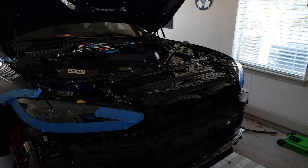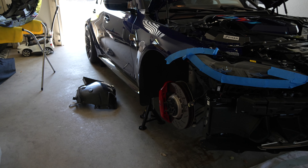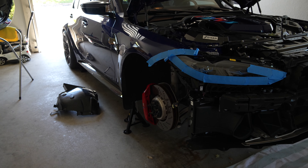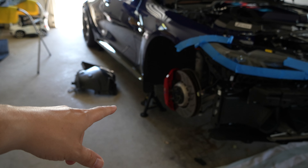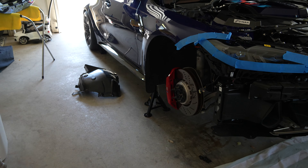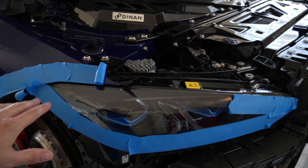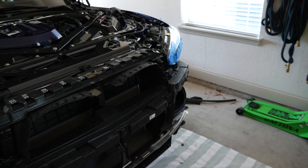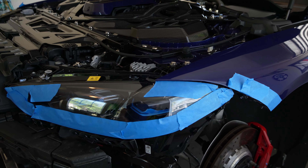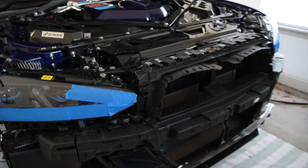If you are looking to do this job yourself, just keep a few things in mind. Jack stands — always a good idea, don't use jacks. I've had this car up overnight. Anytime the front of the car is up in the air, just put it on jack stands. They're relatively inexpensive — I'll link the ones I specifically use right here. They already have the rubber pucks on top, so they're able to be used without buying additional BMW pucks. Also, tape off the painted areas. This car is PPF and ceramic coated, so the front of the fender and headlights on both sides — just throw some blue painter's tape on there as you're pulling off the bumper. And pull both front tires off so you have plenty of room to work.